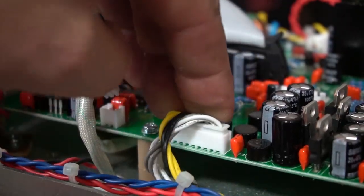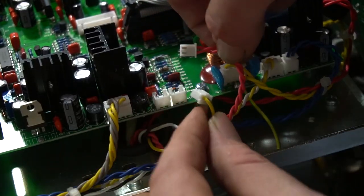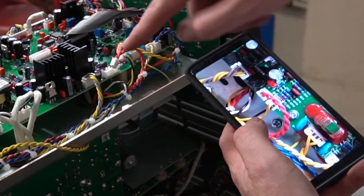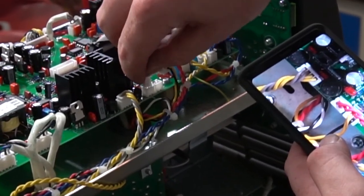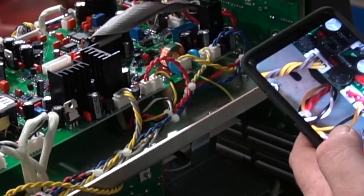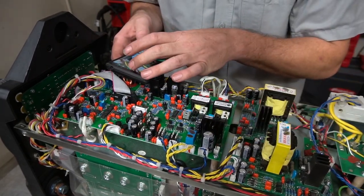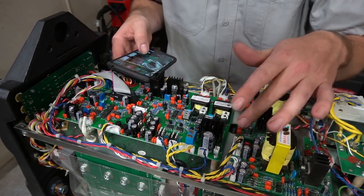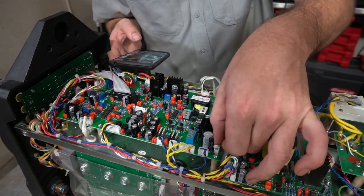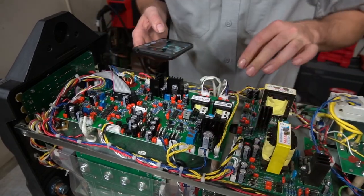Remember: these sockets only go in one way. If it's not wanting to go, don't force it — make sure it's lined up, then press it in. Here's an instance where I couldn't remember which connector was where — I had a pair of two pins right next to each other and didn't know which was left and which was right. So I pulled out my phone: the red was on the left, the yellow was on the right. If you're not sure, go back and check your picture — that's what it's there for. I also made sure every single connector was in place, and I realized I was missing one. Thanks to the picture, I traced it back — it had wrapped around the side and snagged underneath another board. As soon as I found it, I pulled it out, lined it up, stuck it back in, and the board swap is complete.